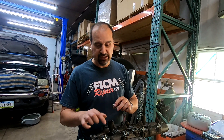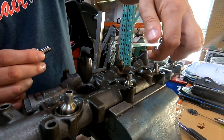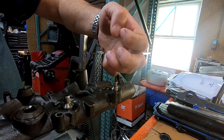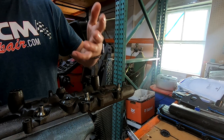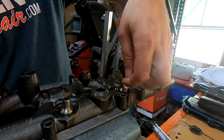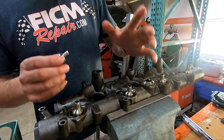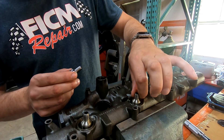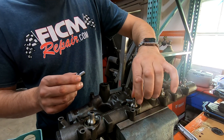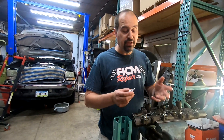Just as an option, you could replace the O-rings and choose to migrate to these aftermarket nipple cups. In addition, you can see there's some wear here — just little lines. The rule of thumb: take your fingernail — your hands will wash — and feel for any nicking. If you feel any marring or nicking and you intend to reuse the nipple cup, take some 2000-grit sandpaper and run it along there to get rid of that edge, or use a Jeweler's Rouge polish with a Dremel.